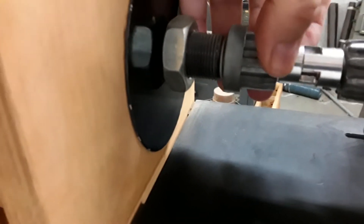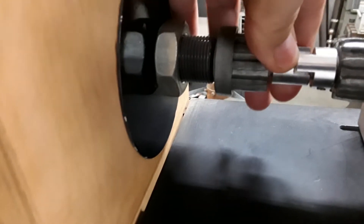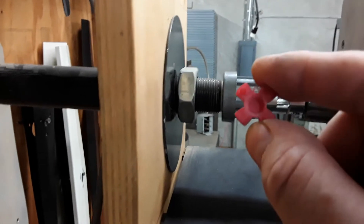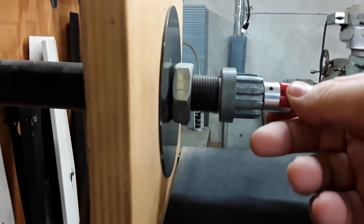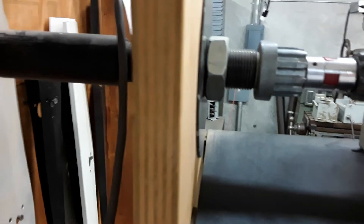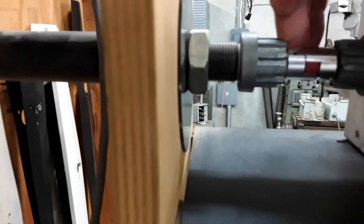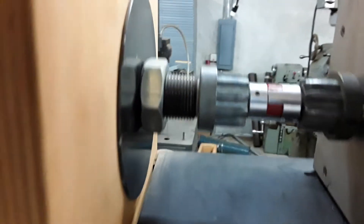As you can see, it's right now moving. This is how you're getting your 15-20 minute movement — that little coupler that goes in here is no longer in there. When you order the couplers, you'll get this little star-shaped coupler. It simply goes on the shaft, and then the shaft goes back together with the hour coupler on the outside.